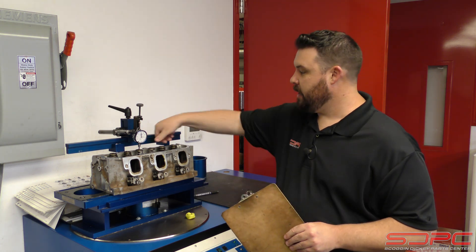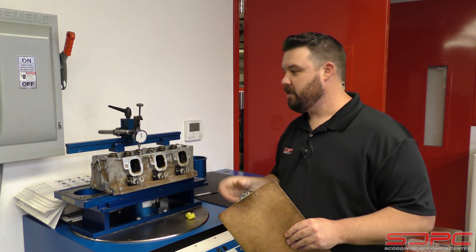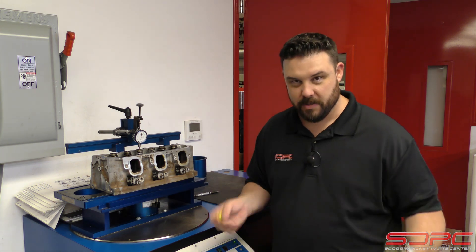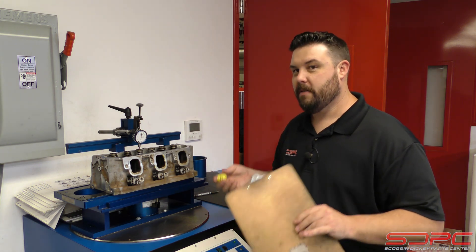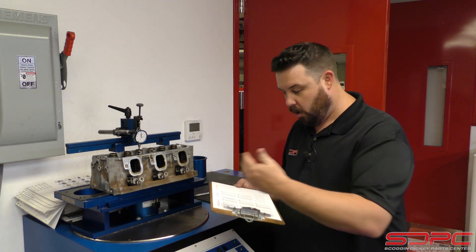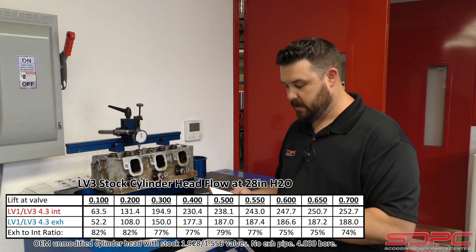Another thing is these valves are actually on a tester spring — that's how we do this. When we turn this dial, that's how we can do that. You can't do that on the actual big valve springs — you'd just break the whole setup. So onto the results: the LV-1 and LV-3, because they do use the exact same cylinder head casting, cylinder heads on the 4.3 flow the same as the 5.3. They actually get really, really close — within a handful of CFM between each other all the way down the row. And we seem to peak right at about 250-ish CFM on the intake side.